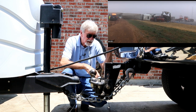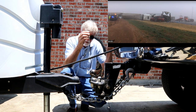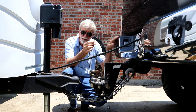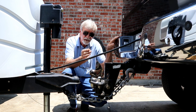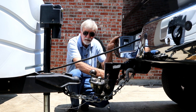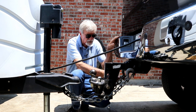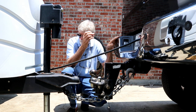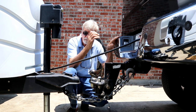After doing a little research, I've kind of concluded that this emergency cable should NOT be woven through your chain like most dealers sell it to you, and it should NOT be attached to your safety chain hook. It should be completely separate. And when you pull this — as you saw in the last video — it locks and breaks up the trailer brakes and you're going to stop.